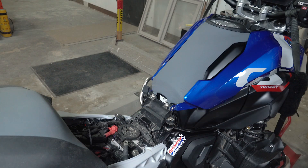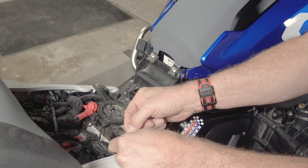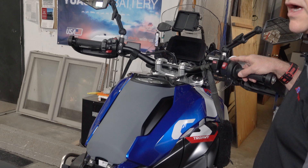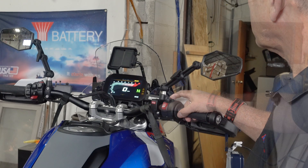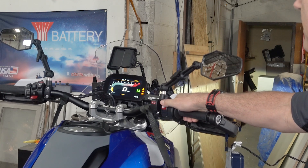I'm going to reconnect the battery. As we reconnect we might see a little spark because the system of the bike is going to draw current. Now we'll turn the motorcycle on and see if everything is working. All good. And this is how you recover the lithium battery on this BMW R1300GS — if that battery could turn itself back on and had a little bit of voltage to activate the charger.